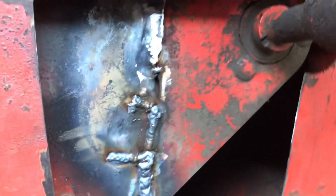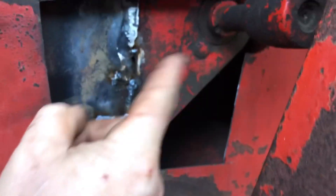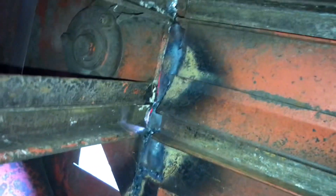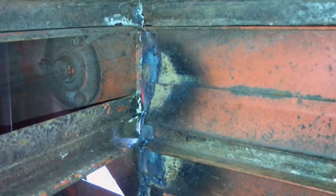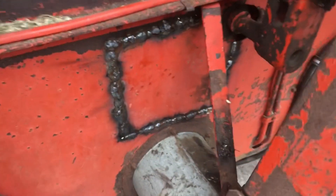We're going to put a big plate here, weld that in, and that'll put the strength back into the combine and close up the gap all the way around. On the inside you can see there's still a gap up here and this section still has to be welded all the way down — it's looking good and we're making progress. Looking more closely I think there's quite an old break there — it probably was a hairline crack being held together at the top and bottom, and as the machine rocked forward and backwards it just opened up and broke. After welding from inside the combine as well, seam welded all the way up with the plate welded on top — all welded up and done.